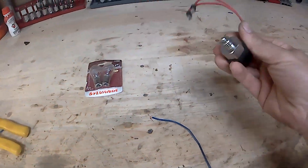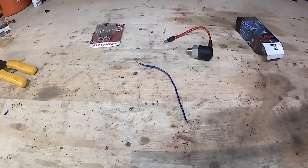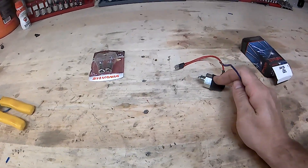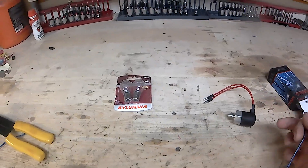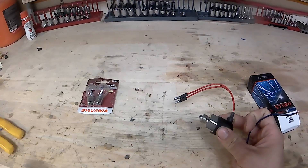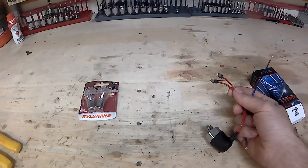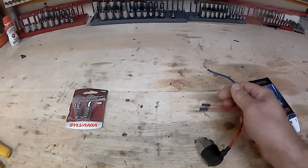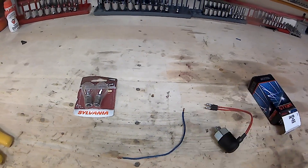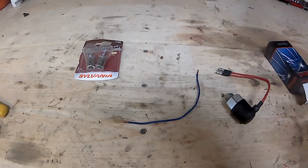So now you pull out your switch, and we'll go under the car and I can show you where that switch sits. Basically you can test the switch for continuity, but another easy test: if you put the car in reverse and the reverse lights don't come on, then unplug it — unplug these two wires from the switch, insert one end of each of these into where these wires go, and if your lights are on, you know it's the switch, because now you're just bypassing it and it'll be on in any gear. So let's go under the car and check.